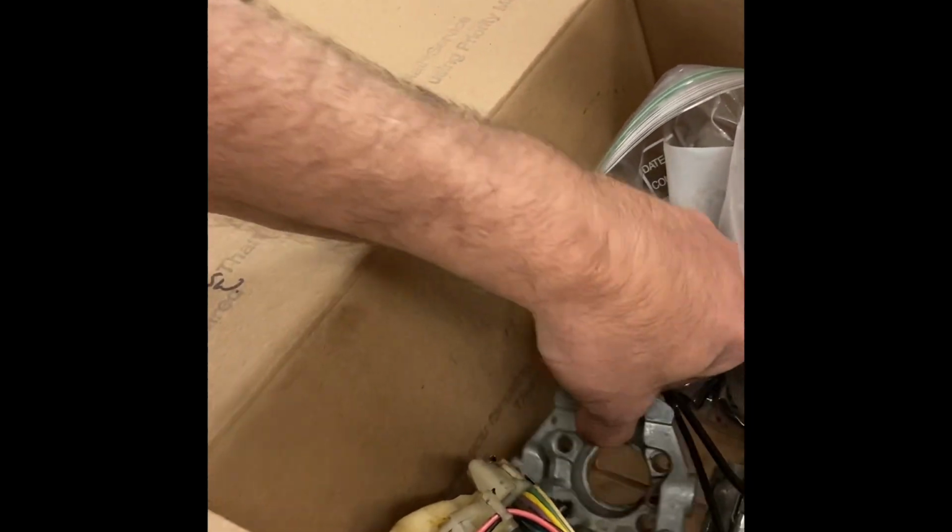So I'll do that. Right now, I just finished. Didn't have to do it, but I went in, took every little piece, and degreased everything because it had 50-year-old hard, chunky grease in it. And those were the things that I wanted built better. So toothbrush, lacquer thinner, I've been out here 4 hours cleaning all the old grease out, and re-greased everything. There was nothing wrong with my bearings. Those were good, except one of them was missing in one column.